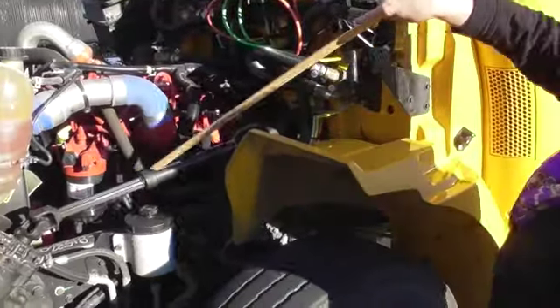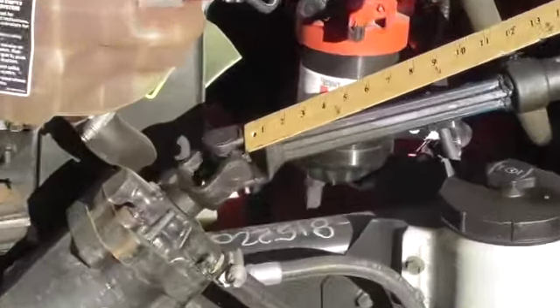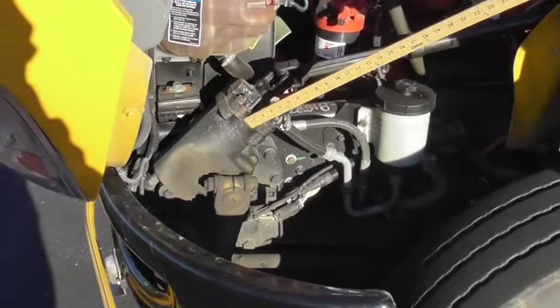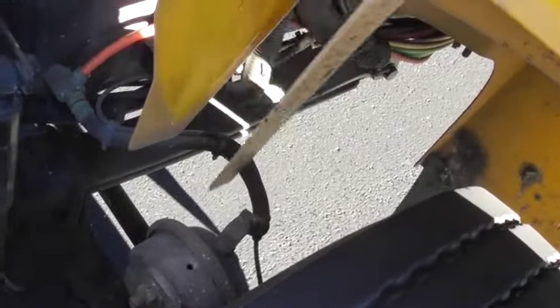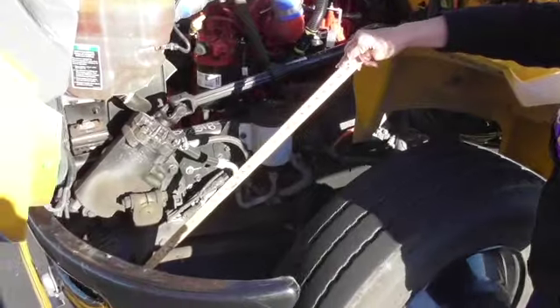My steering mechanism. This is my steering shaft — it appears to be straight and undamaged. On each end there are knuckles that are properly lubed. This is the gear box; it's securely mounted with all bolts in place, and if it were leaking it would be leaking at that little joint — I don't see anything leaking. The next items are the pitman arm, the drag link, and underneath is the tie rod. We group all those together — they are securely mounted, all bolts are in place, they do not appear to be damaged, and all cotter pins are in place.